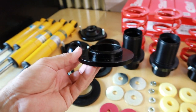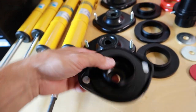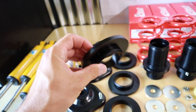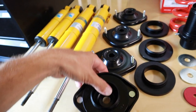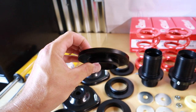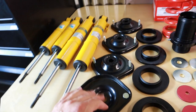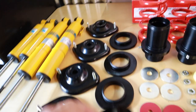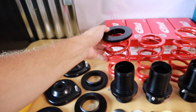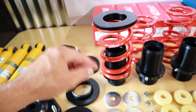Next are the 2.5-inch spring isolators — the Fat Cat Motorsports spring isolators which we now manufacture and distribute. These were custom designed to fit perfectly into the Mazda Miata OEM shock hats. You won't get this fit with a standard off-the-shelf energy bushing spring isolator. These are custom manufactured to fit into the shock hats perfectly and are specifically configured to work with the 1999–2005 mounts — one of the rarities out there designed for this application.